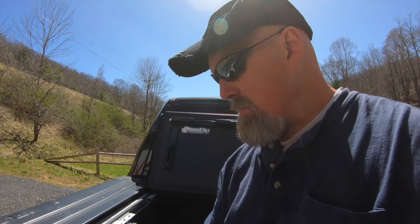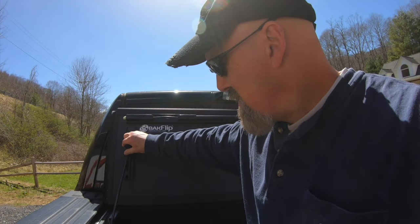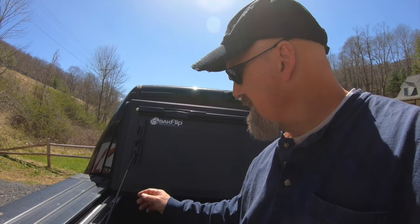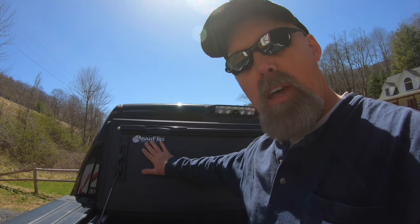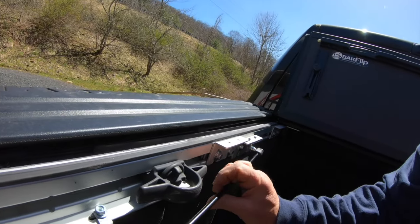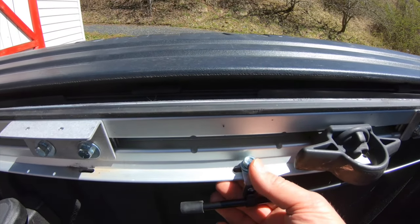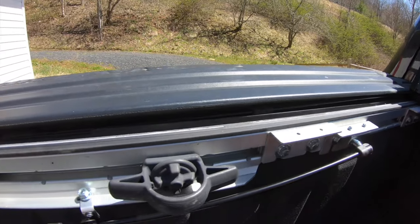For the retaining rod, place it 17 inches away from the front of the bed. It allows the slide to go and lock in place, holding the backflip up as you're driving down the road. Loosen it up — there's a retaining clip that goes through an existing hole on your Ram box. All I had to do was ream out the hole just a little bit, put the bolt in, and tighten those two in place. That completes that step.